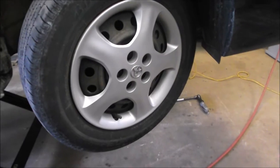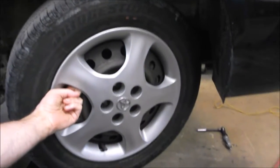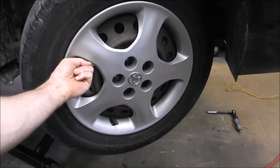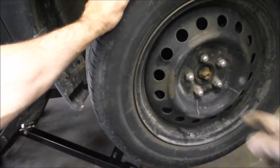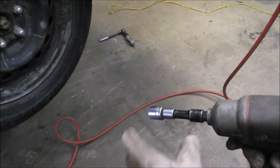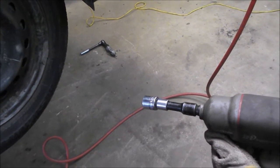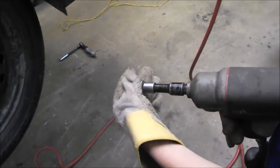These hubcaps are made of plastic and they're quite fragile, so we have to be careful when removing them. To properly remove this hubcap, put two fingers behind each spoke and then pull it straight out. Put the hubcap aside so that you don't step on it. Next we have five wheel nuts to remove, and we're going to use an air impact wrench. Normally we would use a 21mm deep impact socket — the black type used for impact wrenches — as chrome sockets could shatter when you're using an impact wrench.